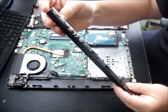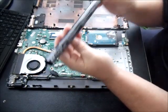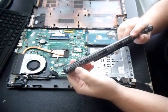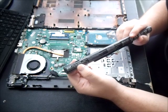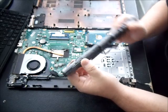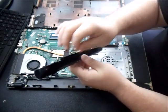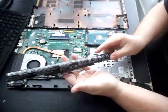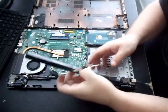To replace the battery, pull off the model number label on it. This particular one is an AL15A32. You can go on Amazon or eBay, search that model number, and get a replacement battery.